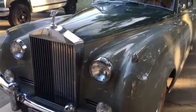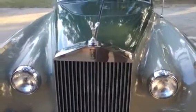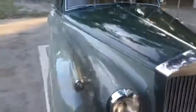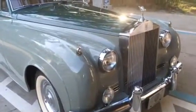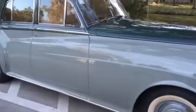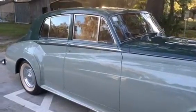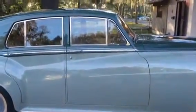The mechanic work consisted of a full brake job. This car comes with dual wheel cylinders in the front, upper and lower, and it also comes with a little bit different system than what most people are used to. It has two master cylinders down in the frame rails and an actual mechanism on the transmission that has a disc that actuates what I would call the master cylinders.